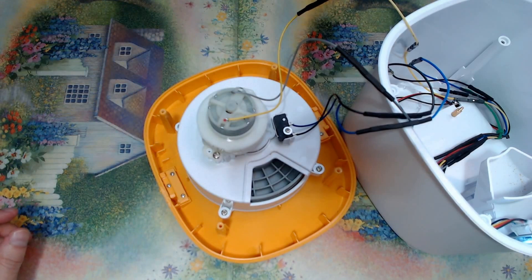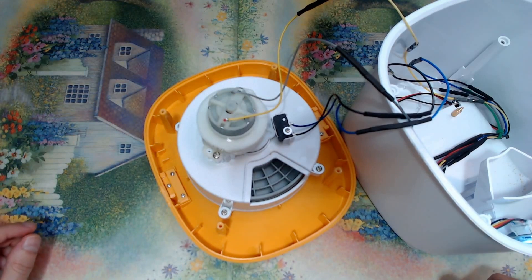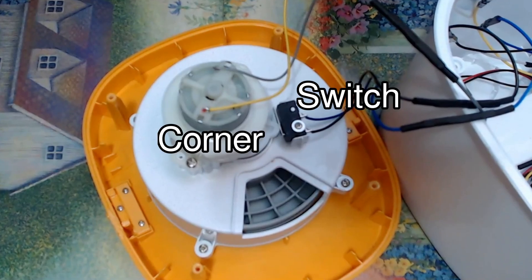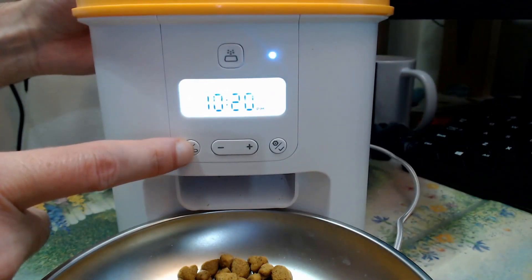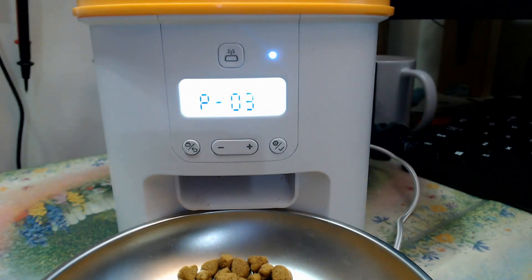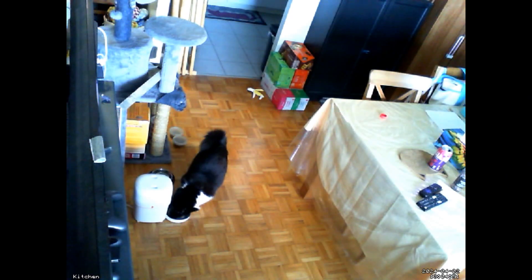Deep dive: how the automatic feeder works. My automatic feeder has a motor that spins a drum which takes in kibble and dispenses it in portions. The drum has three rounded corners that press a switch, which is how the machine knows the position of the drum. One full spin gives out three portions. The feeder has a screen and buttons for either automatically feeding on a schedule or for manual feedings. The screen locks after a short period — I'm guessing to make it harder for an animal to operate it with their nose, and they will try.